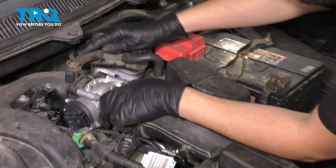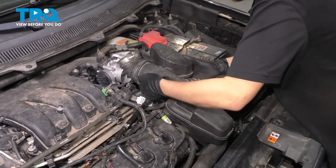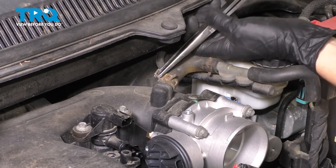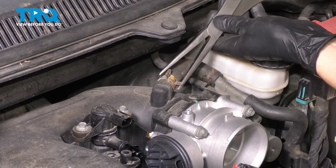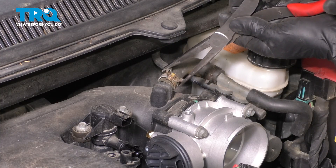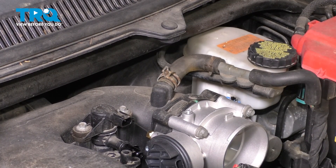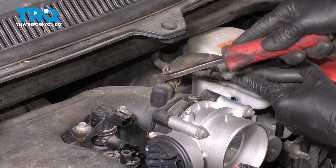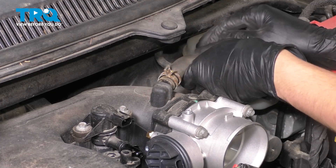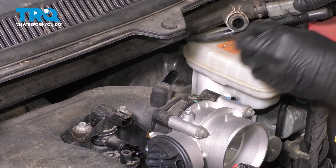Looks like we have a hose attached over here so I'm going to unplug it. This should be able to slide up now. Unclamp this hose — use some pliers and twist the hose clamp so you can grab it. Once the hose clamp is released you should be able to pull the hose off. This one actually has a lock on it so you can lock it in the open position and leave it until you're ready to reinstall. A lot of times these rubber hoses get stuck, so use something to very gently pry it, give it a couple twists and it should break free.